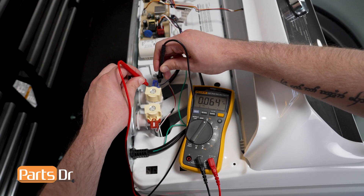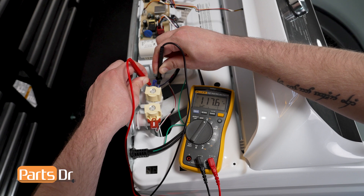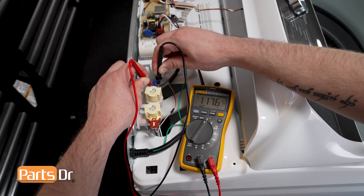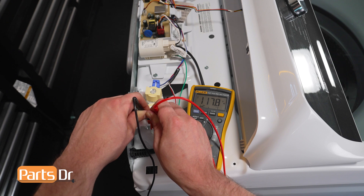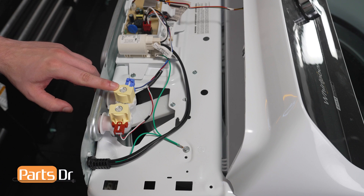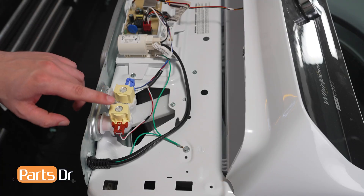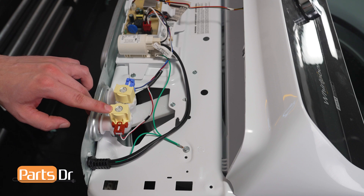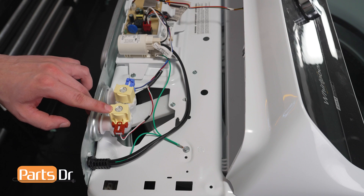With the cycle started, touch one of the probes of the multimeter to each of the metal tabs on either the hot or cold side of the valve. When the control board sends electricity to the valve, the voltage reading will climb — it won't be immediately after starting the cycle. Our washer will engage the cold side of the water valve around 47 seconds into the cycle and the hot side of the valve around 1 minute 15 seconds into the cycle. The valves may not get power or open at the same time, so you'll have to alternate between testing each side more than once to ensure the valve is receiving power and opening. You should be able to hear the valves open and the solenoids inside the valves buzzing when the power is being sent to them. If the power is being sent but you cannot hear the valves opening, it is most likely broken. If either side of the washer inlet is failing to get power, that means the control board may have gone bad and may need to be replaced. If you're getting power to the water inlet valve and still having issues with the washer not filling properly, the water inlet valve has most likely gone bad and may need to be replaced.